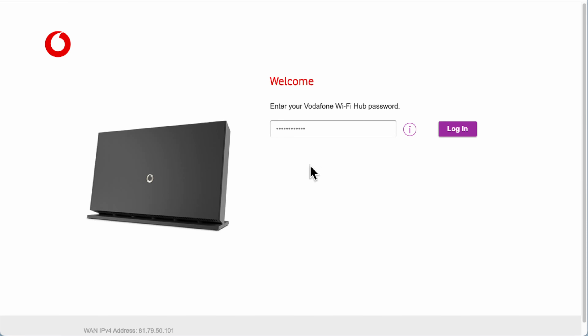They've got an app but I do prefer to use this via web browser — you can use it on your tablet or phone using Safari, Chrome, Firefox, or whichever browser you want. What you'll need to do is log into the router first. The address you type in is 192.168.1.1, and that will bring up the load screen. You just type the password found at the bottom of the router and click login.